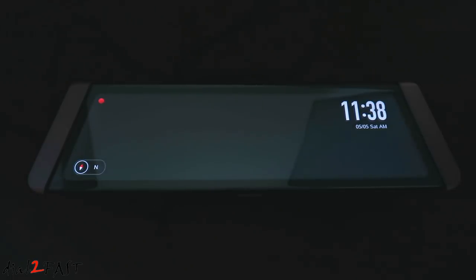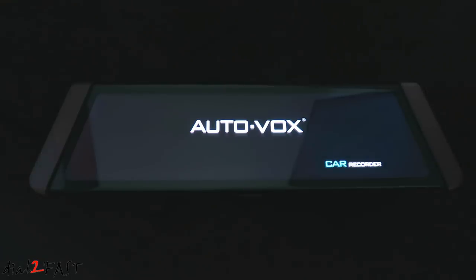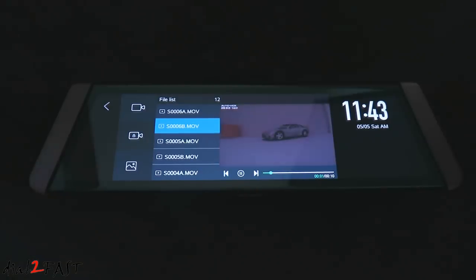I'm going to set this for high right now and exit the menu. Now disconnect the power to the dash cam, simulating you turning off the ignition — you see the unit turn off. Right now the dash cam is still recording using the internal battery. I'm going to simulate an impact to the vehicle by tapping the mirror. At this time the dash cam will lock that video clip. Now turn on the dash cam, stop the recording, go to playback, and go to lock video. This video clip is from when it detected the impact and locked that video clip. The parking mode feature does not require the dash cam to power up when it detects the impact, and is able to lock that video clip quickly. This is how the parking mode feature works on the AutoVox X1 dash cam.